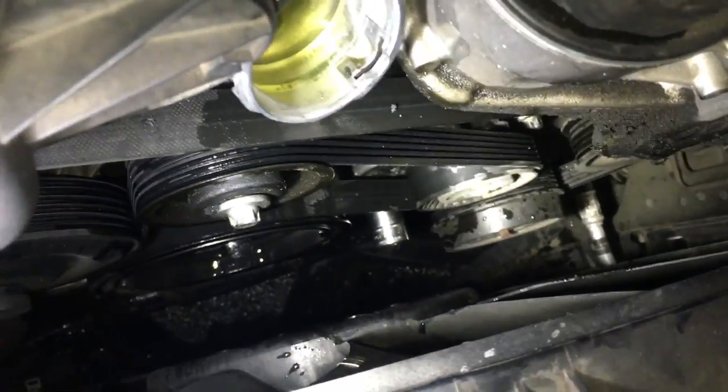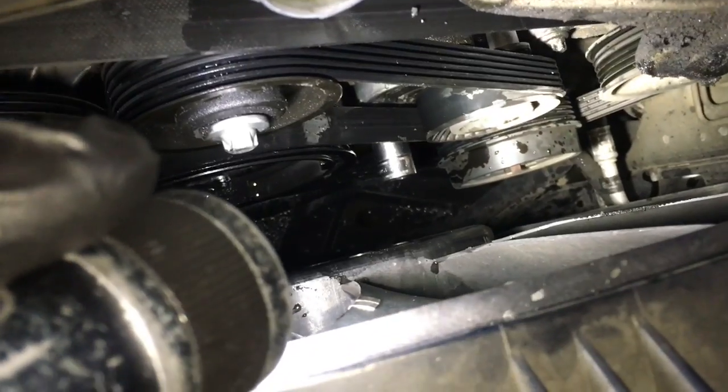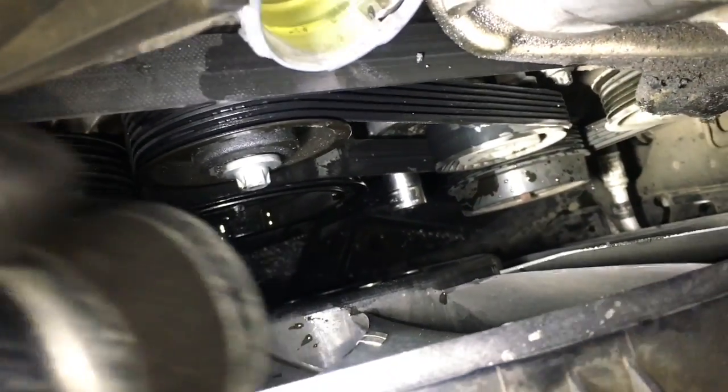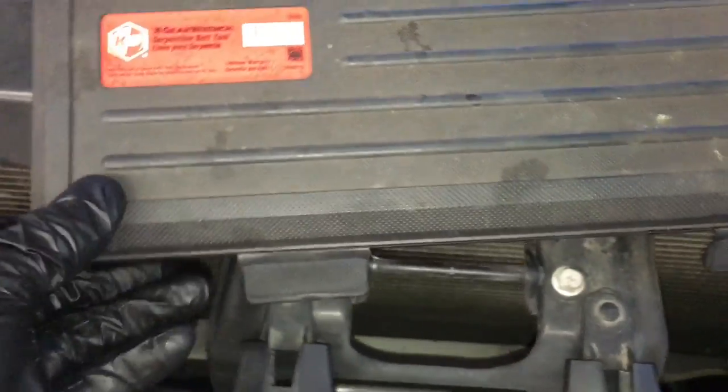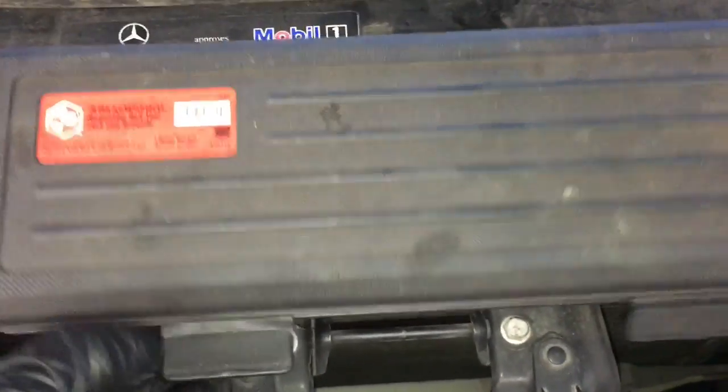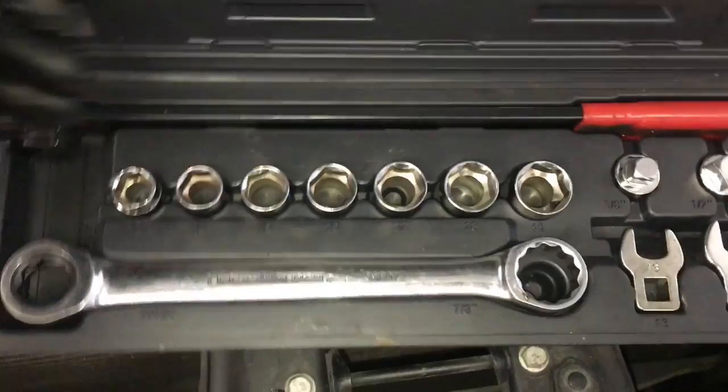So now that we've got the hose off, we need to remove the serpentine belt, and to do that, the serpentine belt tensioner is right here, and right underneath the belt is a spot where you can put a 17 millimeter socket. And then I'm going to put my serpentine belt tool here. I'm going to show you this. I'll link this up in the description in case you need to pick something like this up.